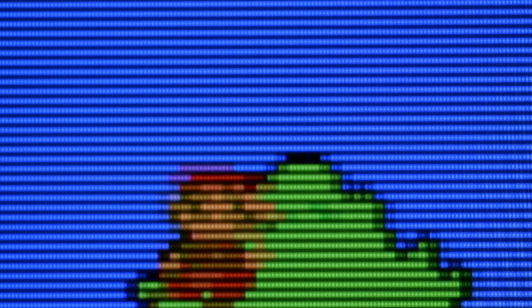Modern televisions and computer monitors use fixed pixels to display their image, which differ greatly from an electron beam drawing an image across a phosphorescent tube. Digital displays configure their pixels to show an image and then hold that image until the screen refreshes. On a 60 Hz television, the image is held for a full 1/60th of a second. Then the screen refreshes and a new image is held by the pixel for another 1/60th of a second. Let's take a look at Super Mario Brothers again, this time with the RetroTink 5X outputting 1080p at 60 Hz.